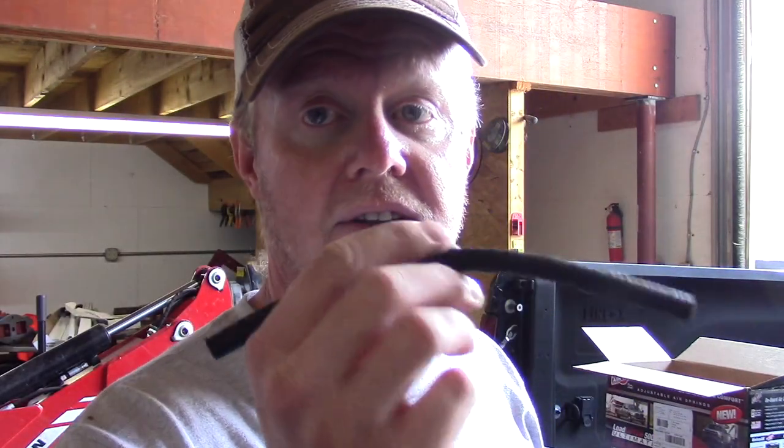But don't forget to put this on before you plug it in, because this is another heat shield that you want to put where it actually goes to the airbag, the closest to the exhaust. This will shield the airline from the exhaust.